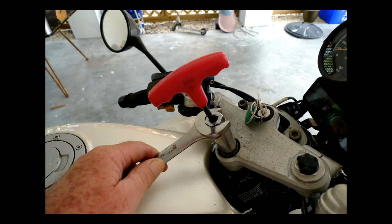So now the big question is, how do we get to the switch? The switch on the top is the key; on the bottom is the switch. We have to remove the top yoke, and as you can see here, it's a little homebrew contraption of a spark plug socket, an open-end wrench, and an allen bolt, because this nut is in a recess and rather difficult to get to.